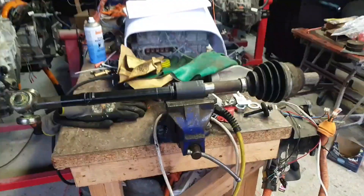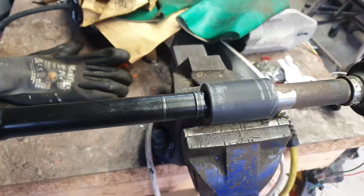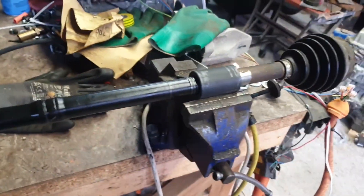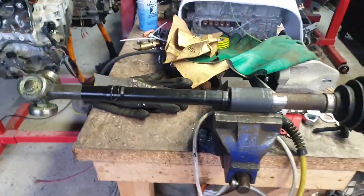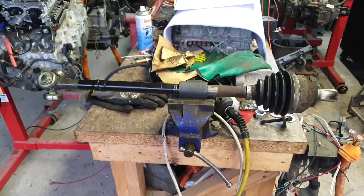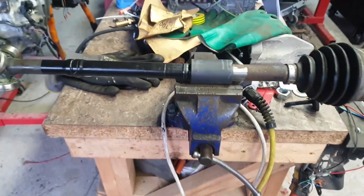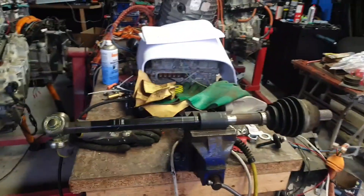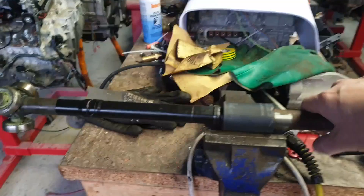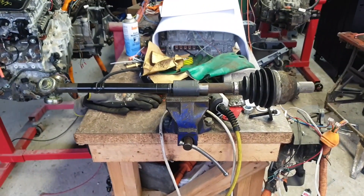With a little bit of magic from the old 3D printer, we have our polycarbonate carbon fiber coupler shrunk on there — got our Tesla inner and our Ford outer. Obviously, before the internet goes mental, these are for alignment purposes only to make sure we get our drive shaft length correct. We'll be taking both of these back out, getting them made from steel, sweating them on, welding them up, and installing with a CV boot on each end. In the meantime this is more than strong enough for alignment purposes, so let's throw this in the car and see how it looks.